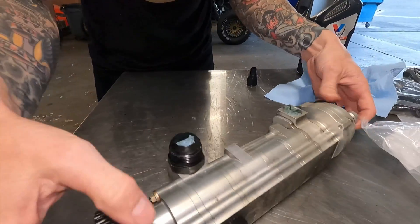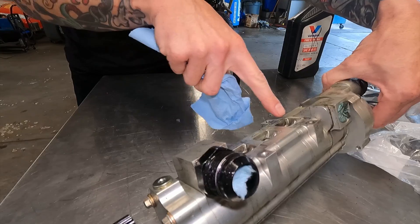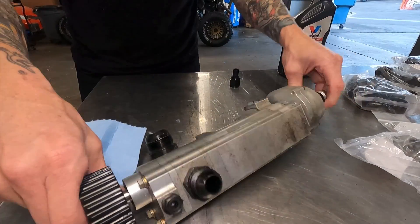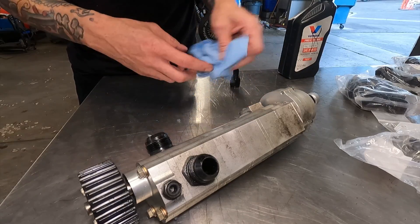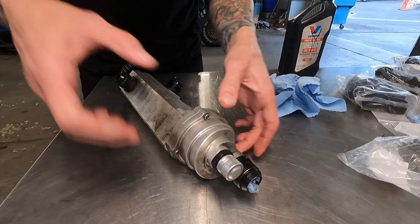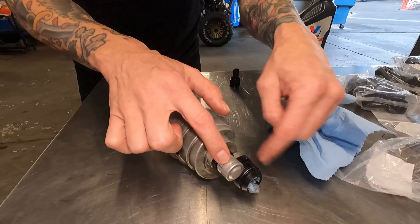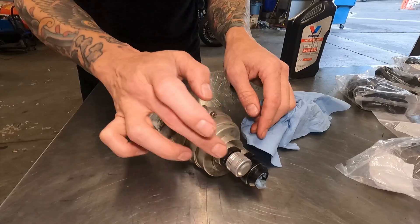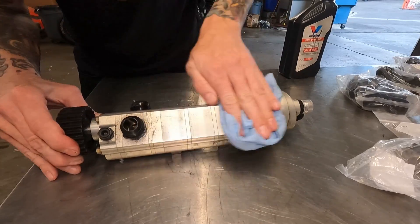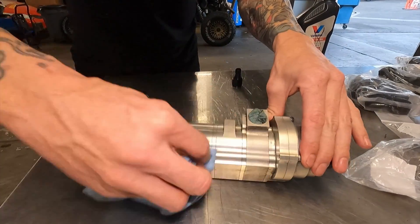We're going to try a dry sump pump from Daily Engineering — it's got multiple stages. This one pulls three from the pan, this one pulls from the front of the pump and goes back to the tank as the main feed. This is the turbo drain, so it actually sucks from the turbos down into the pump. And then this is the little aerator block, which helps get all the foam and air bubbles out of the return line. This will run up to the top of the tank — they'll go in separately — and it helps get that oil to mix perfectly.